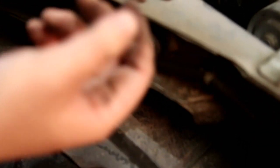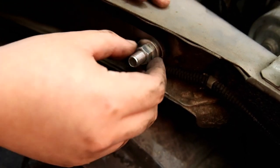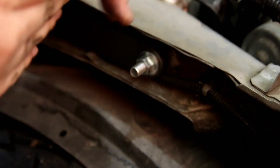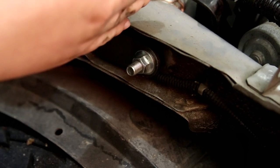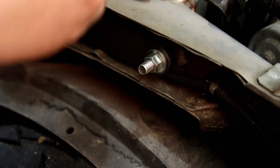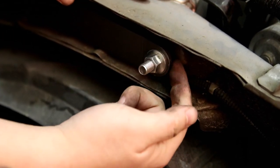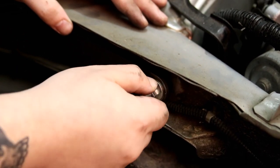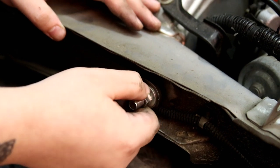When it comes with a spacer, that little T-flange bolt thing, and a nut and spacer — the T, you flatten it, put it inside the hole of the chassis, then make a T so that it's stuck in there. Then you put the spacer behind the brace, and then the washer and the nut on top of that. Snug all that down and there you have it.